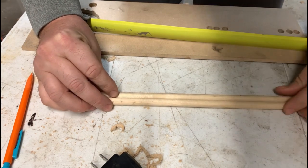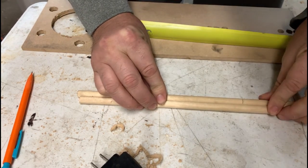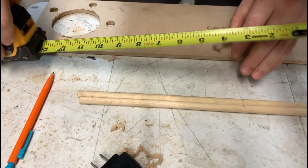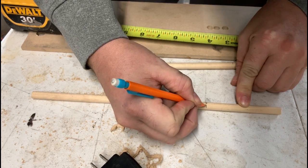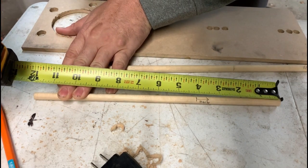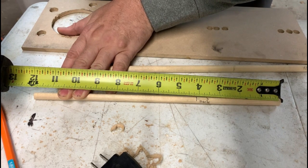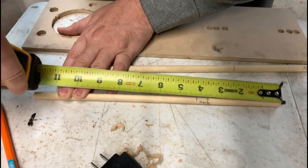I'm going to rotate this until you can see the back spacing mark, and I am going to transfer the back spacing mark onto my wheel dowel. To check your back spacing — being that this is the rear or the back of the wheel — my back spacing is going to go from the very rear flange all the way to that back spacing mark, which is 4 and an eighth. So my back spacing for this wheel will be 4 and an eighth. The overall rim size will be an 18 inch by 11 with a 4 and an eighth inch back space. I hope you guys enjoyed the video. Remember to click that like button and hit subscribe if you'd like to see more like this. See you next time.